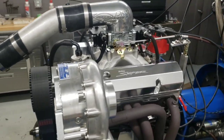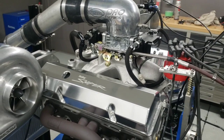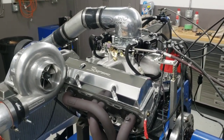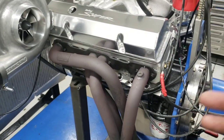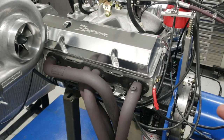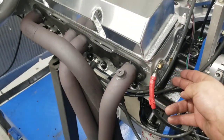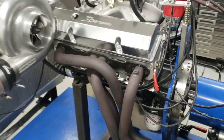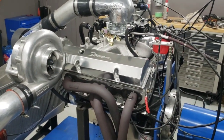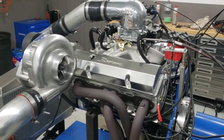Cody wanted to have really good horsepower on pump gas, which these things will do, and then have a race gas tune with just a simple pulley change. This one is much more street strip, obviously. It's a solid roller, our stage two camshaft. We still left this with a conventional-style head gasket versus doing an SMX hoop and copper O-ring receiver groove kind of deal. So this is really old school, conventional way of doing the whole thing.